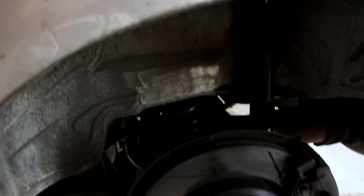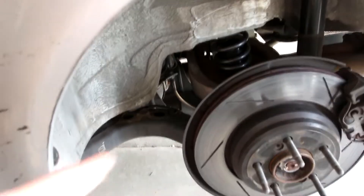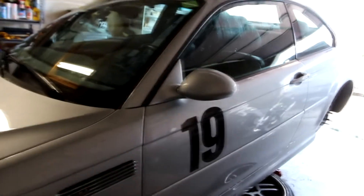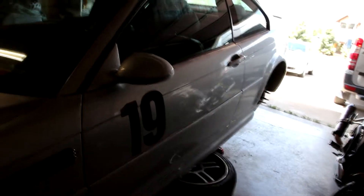Now, as I've mentioned before, I've done a few things to the rear suspension — in my opinion, the major components. I have done new coilovers on the front and back, and then on the back I've also done rear lower control arms so I can get more camber on the rear wheels. The front ones, obviously, with the coilovers — that's not an issue. I decided I'm going to continue down that path first before I jump to anything else, because the suspension makes the car handle a lot better.